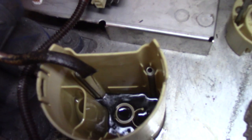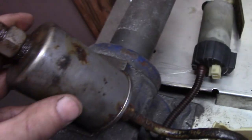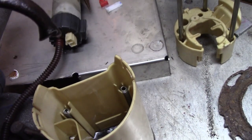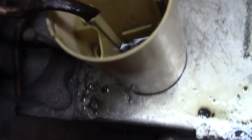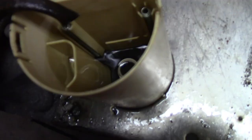Anyways, that's all I got, thanks for watching. That is literally the dirtiest fuel I've ever seen — it's like motor oil. I'm just draining it out of this fuel filter. I'm hoping this is my problem. That does look like motor oil — it's supposed to be gas. The way it's coming out of there, it's just like chocolate milk. So maybe the fuel pump was okay on the old one — it's just blocked in there. If you watch to the end here, this is probably what the problem was, why the truck was starving for fuel. Probably should have started with the fuel filter — but got a new fuel pump in there anyway. Thanks for watching.